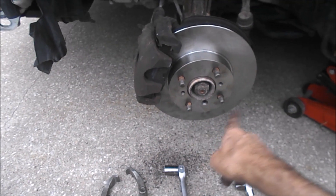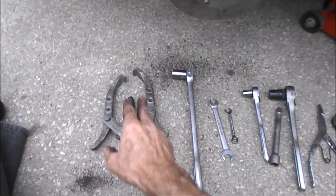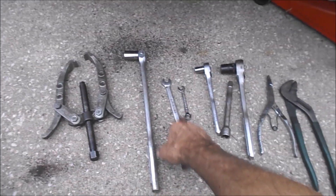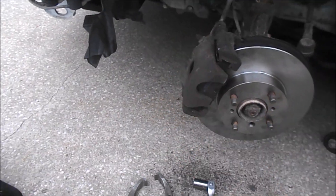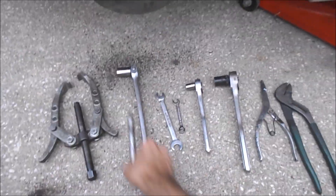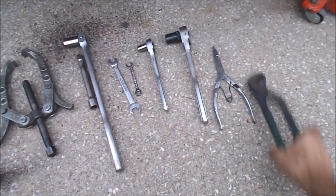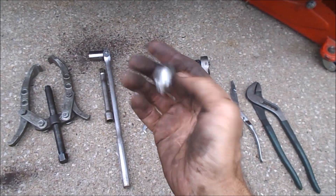It's on. I've got to wipe it down, get my rag and wipe it off a little bit. To get the job done, you need yourself a puller, and a wrench with a breaker bar to apply additional torque. A couple of wrenches — 12, 17, whatever — for the bolts back in here. You can also get to those bolts with ratcheting wrenches, an extension for that one right there, and a circlip spreader for dealing with the piston. And for me, some channel locks to apply additional force to the circlip spreader, and of course some kind of wrench to get your lug nuts off.